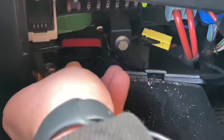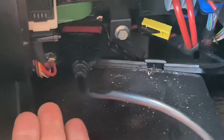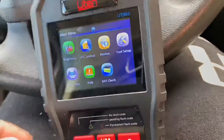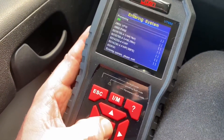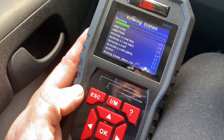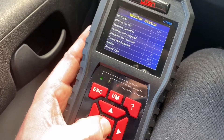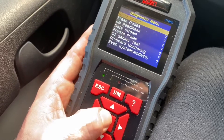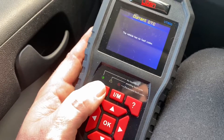It's a small, fast scanner to detect failure codes and to read and delete them. It's not for deeper diagnostics — it's a standard approach. Switch on the ignition; you do not have to start the engine. Then go to diagnostics. We are now entering into the system, and in this case we can see there are no failure codes.